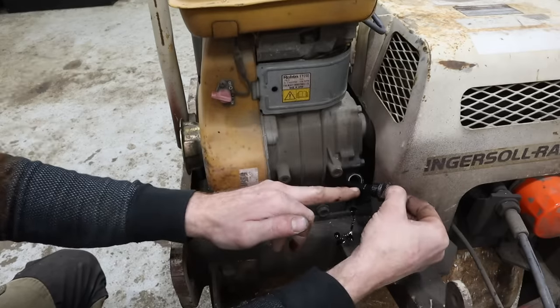The other thing is the filter on this machine. Since this is a hydraulic system, usually they have a seal right here. So there's the outer one, and the inner one is basically made to keep pressure from bypassing the threads, and if that happens, it literally totally bypasses the filter, and so therefore you're not getting the protection of the filter filtering the oil as it comes through. You're just getting it from whatever does go through. And so if it bypasses the threads on the filter itself and filter housing, your system isn't staying as clean as it should be. So obviously that's not a good thing in the long run.